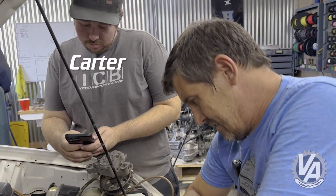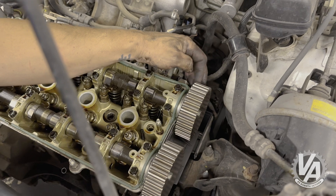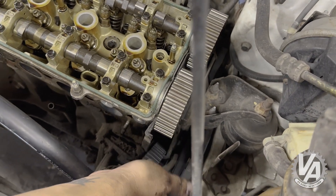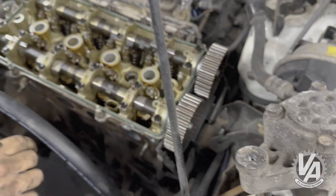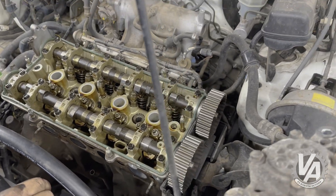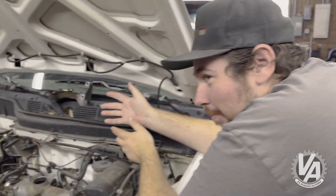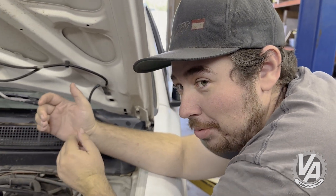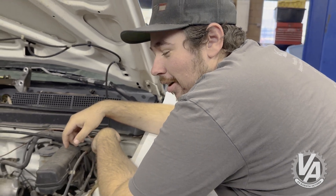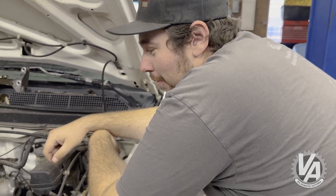Carter's here, he can finish this up. If you look here, here, and here, you can see pieces of it. Oh, it separated nicely. Well, it's jammed down in there. That was 4,500 RPM in third gear doing about 70. I've heard them snap before in friends' cars — there's always metal clinging and the car just goes silent. That's what happened with that green one I bought. So I'm hoping nothing made contact. Either way, we're replacing the head. This happens because too much VTEC.